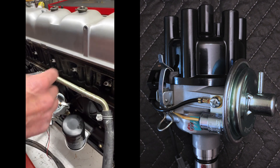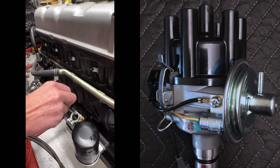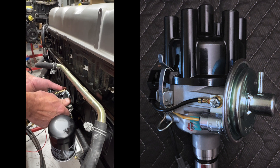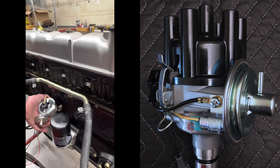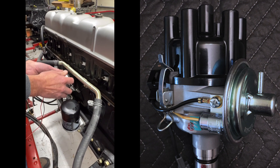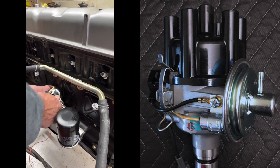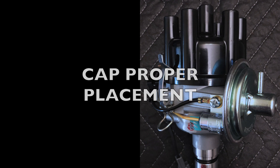These clips will be closer to the timing cover. If you have our camshaft, you're probably going to put them in this position. If it's a stock camshaft, I like them just a little bit over. So I'm going to move this just a tinkle to the left — you can feel the oil pump move just a tinkle on the screwdriver. I like to go up and down and feel the tooth to see if I'm on top of it or going down the side. Now I'm too far to the left, so just a little to the right. We'll call it there.